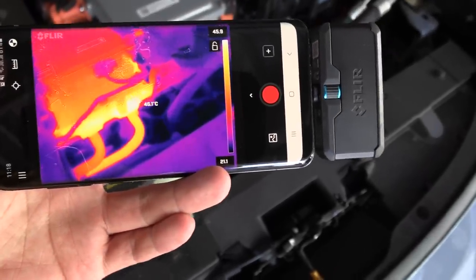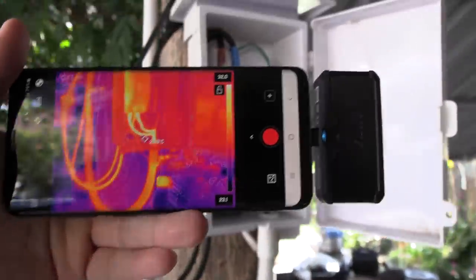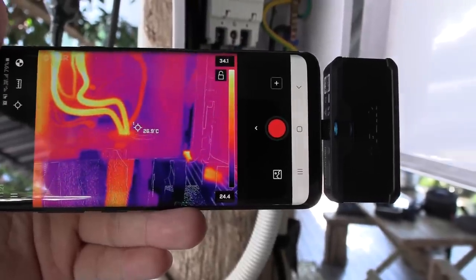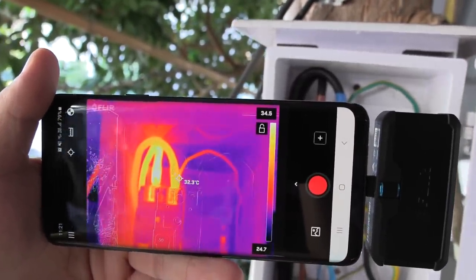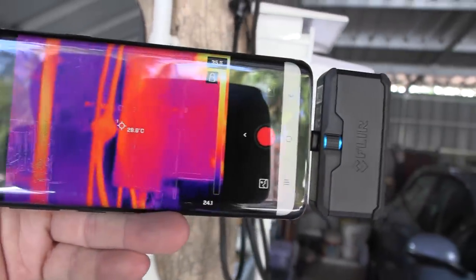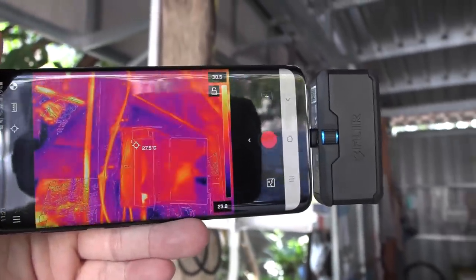As expected, you can see one part here is hot — 40 to 45 degrees Celsius. That's where the heat went. This unit is the onboard charger. Now let's check the cable connections. At 32 amps we see around 30–33 degrees on the cable shoe — no problem. The joint here has the same temperature as the rest of the cable: 29 degrees Celsius. This is exactly the way it should be.